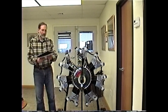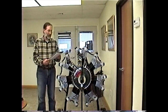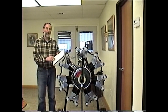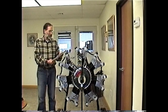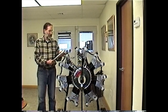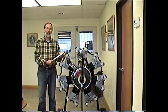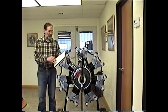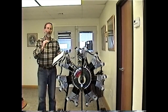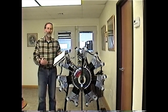In the operator's manual, we're going to be doing a 50-hour inspection — a 50-hour check. Some of the items have asterisks beside them. At the top it says the asterisk means we're supposed to check these items at the first 25-hour inspection after installation, and every 100 hours thereafter. So asterisked items get checked 25 hours after the engine is overhauled and then every 100 thereafter. All other items in this list are checked every 50 hours.